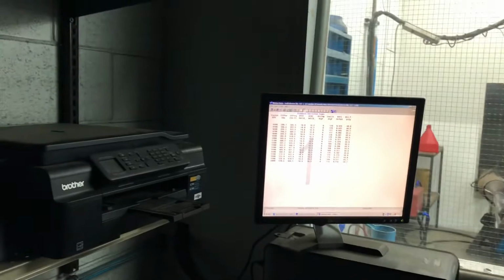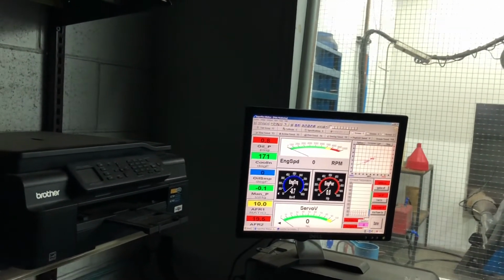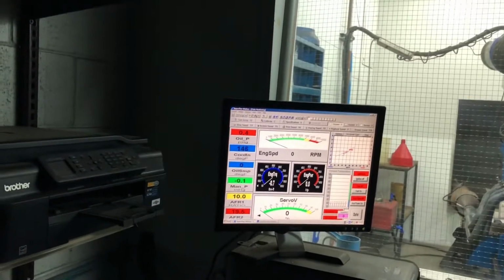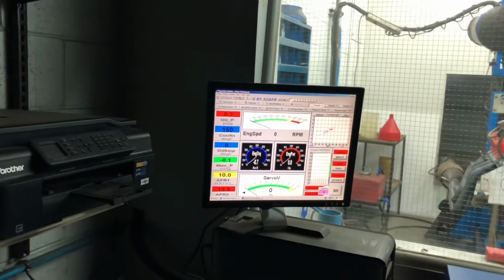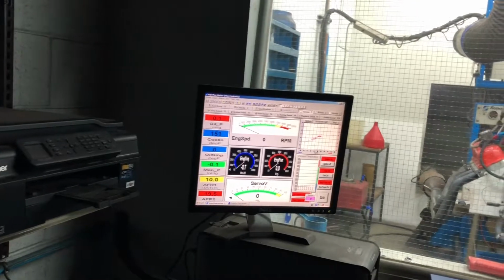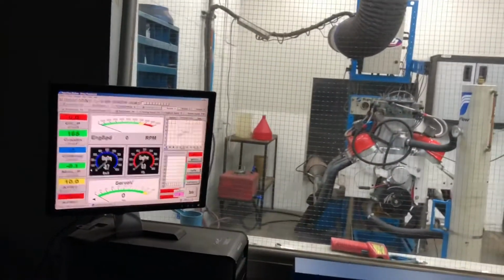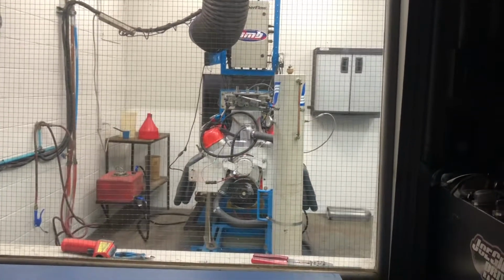See, we did a big change and it didn't really. But see, BSFC. From the last pull, where were we on fuel? I never completed the pass, so you don't record it. Okay. So honestly, with brake specific fuel consumption that low, it would tell me we're still like four jets away. I took a video of the screen before. I can tell you where it was before the four jet change. Okay, I'll go look. All right, so what jets are we at now? 95 squared.